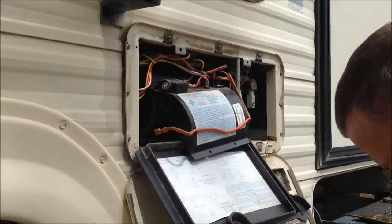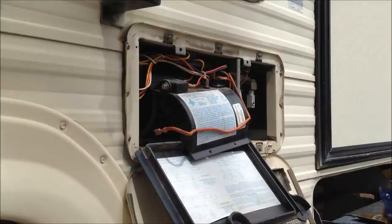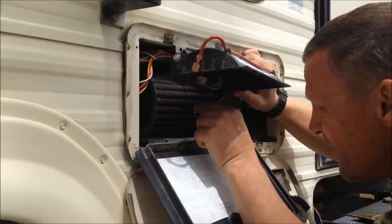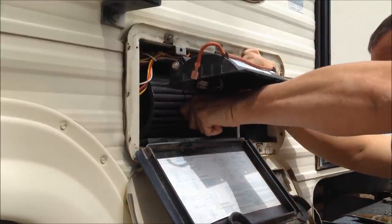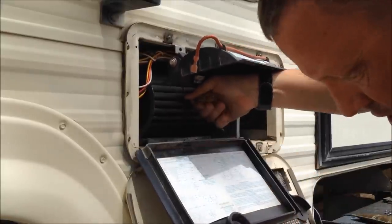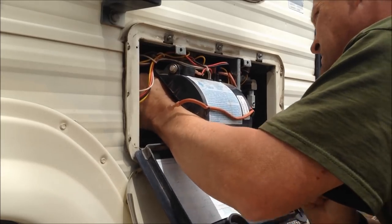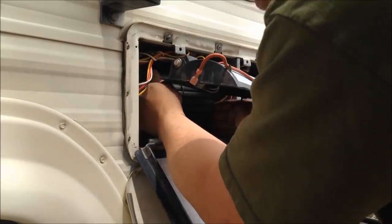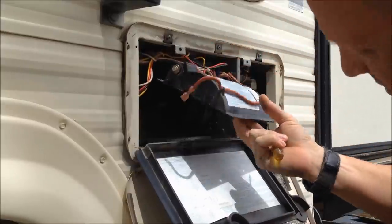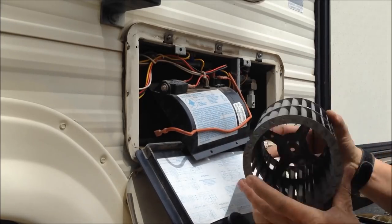Toss these back in and loosen the other side. 1/8th inch — let's try this one in the slot provided. I need the wrench on that too. Loosen that, and then with some persuasion I should be able to pull that fan off of there. There's the fan — and it's dirty, it could use a cleaning — but that's what the blower fan looks like. Set that to the side.